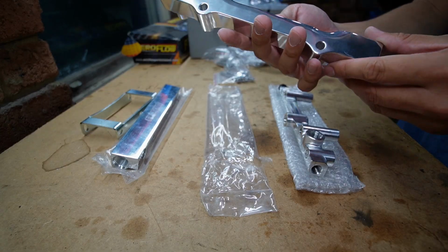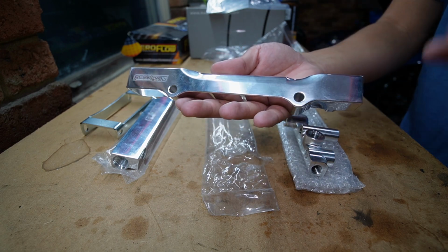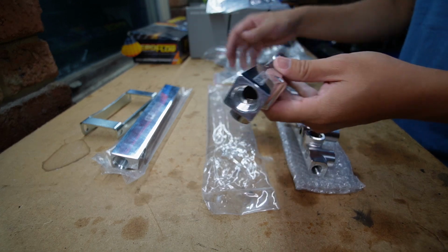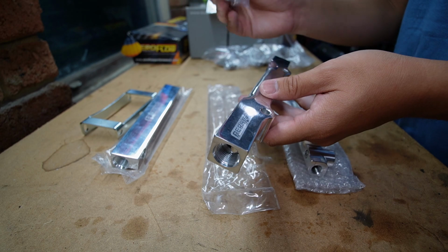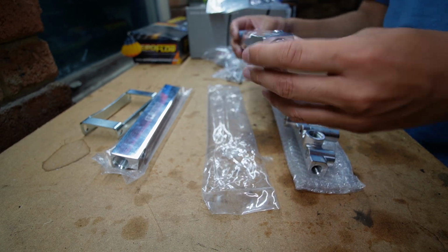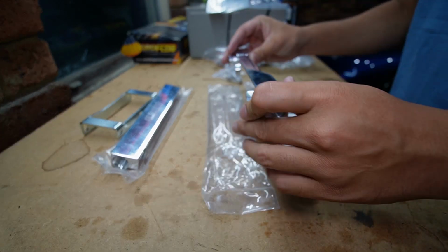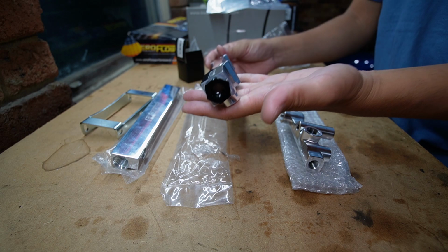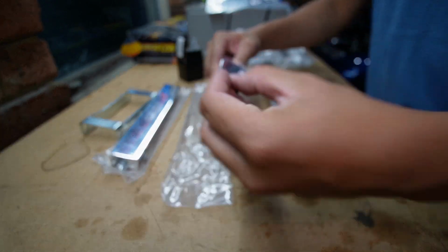And conveniently at the same time, Aeroflow released this Gen 2 rail. It looks a lot more thought out for the FD, and what I didn't like about this rail is the way you mount it and bolt it down. It's just with the washers and some bolts. So yeah, I think this design is definitely an improvement, but not ideal still. And in order to run this style of fuel rail with the FD just as a step-up fuel upgrade, you're gonna have to run this fitting and then the banjo bolt.